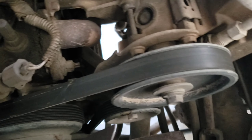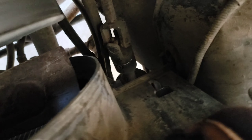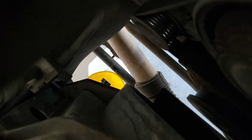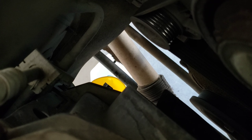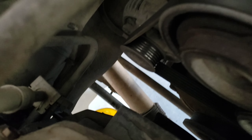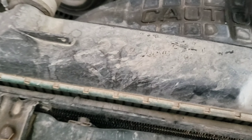Next, you'll want to get the fan shroud off. There are four bolts and they are all 7/16ths. You can see there's one here — it's really hard to see, but basically there's another one down here, and then there's two on this side as well. My hands are too big, but there's a fourth one down there. Go ahead and get those four bolts off so you can get the fan shroud off.